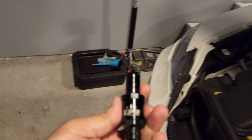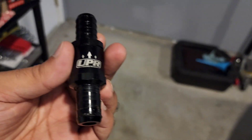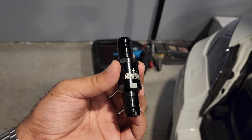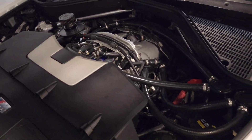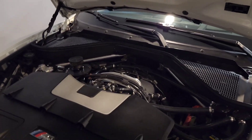Long story short, I had the truck like that for almost a year until I decided to change the check valves and put in some aftermarket ones. I went with UPR check valves, which are rated for 0 to 100 PSI, but that's mostly positive pressure, not negative. The BMW S63 system uses something like negative-positive check valves.